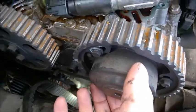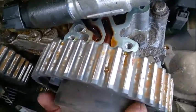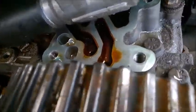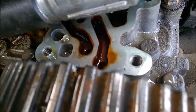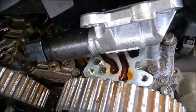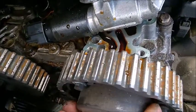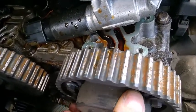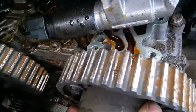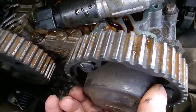Variable Valve Timing hub — this one has one on the intake. I did remove the valve cover so you can check the oil. When you move it a little bit, you can actually see the oil jumping out from there. That's the timing adjustment — the advance — which is done with oil pressure via the solenoid. Depending on how many hubs you have, this one only has the intake.